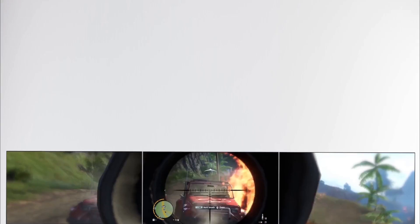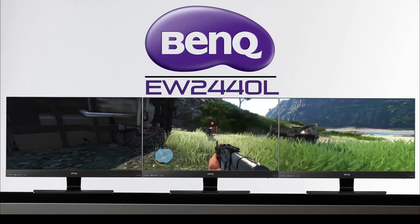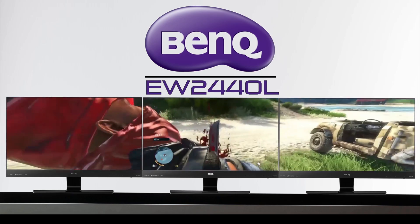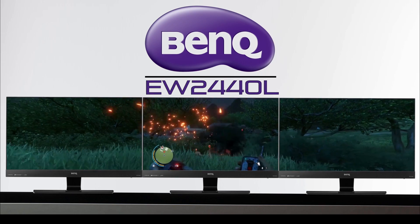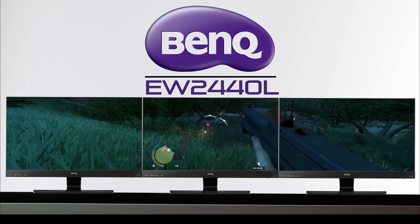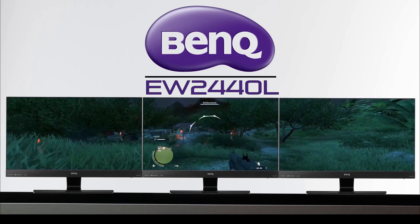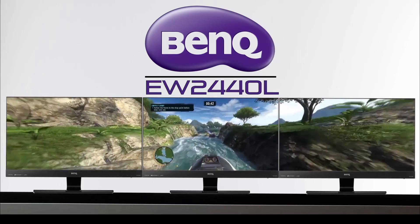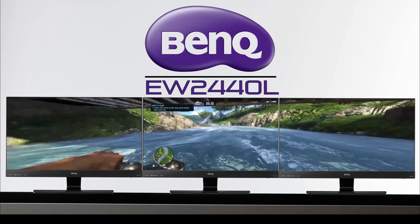Starting with 24-inch monitors, there are two particular ones I really like. The first is the BenQ EW2440L, which probably has one of the thinnest bezels you can get anywhere. However, there are two downsides: it doesn't have a DisplayPort connection, so you'll need to buy an adapter for one of the monitors — though you only need one adapter and can hook the others directly to your graphics card. It also doesn't have a VESA mount, mostly because it's such a thin monitor. Most super-thin monitors don't have VESA mount connectivity.